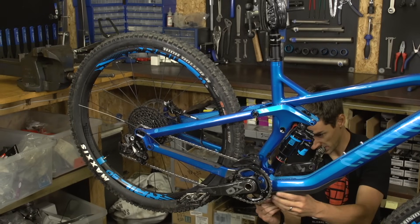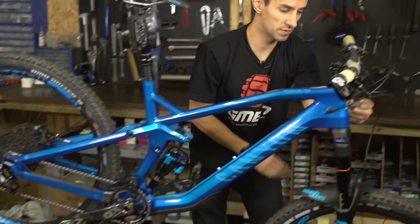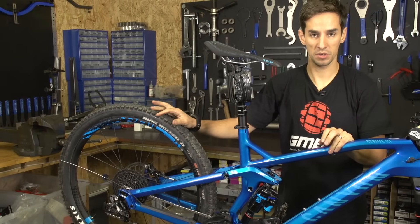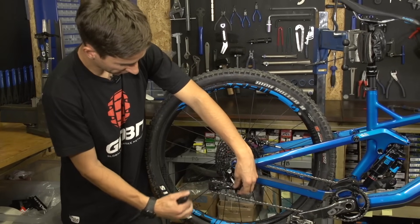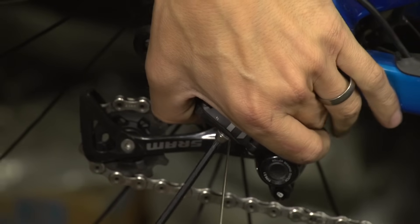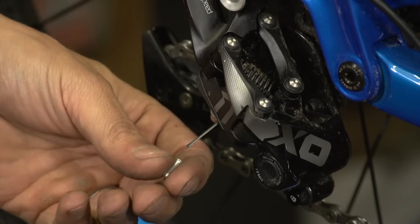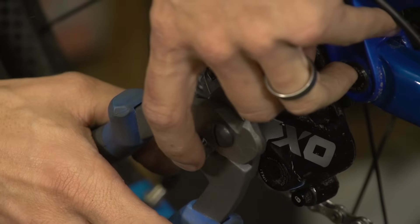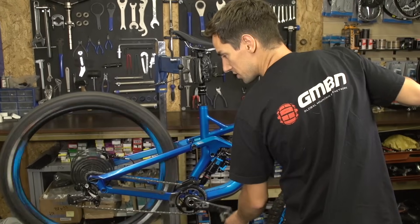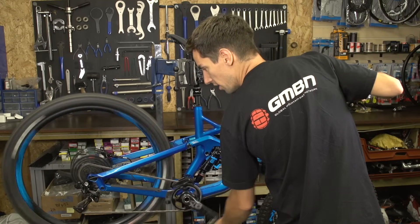All I'm now gonna do is just make sure the cables are butted up nicely into their positions in the frame, so the end caps are sat nicely there, nice and tight. And then I'm ready to start playing around with the actual cable tension to get my gears working properly. I've threaded the cable back through the rear mech and it's by this pinch bolt, so I'm just gonna put a little bit of tension on there and tighten down this pinch bolt. So I'm just gonna snip the new inner cable down nice and short, and put a nice end cap on there just to tidy it up. I'm just gonna spin the bike through the gears and get the tension set correctly on the gear cable - it's a little bit slow going up the block, so I'm gonna put a bit more tension on there. I think that's good to go - check it coming down, nice and smooth.